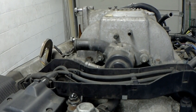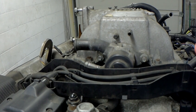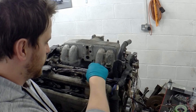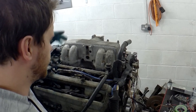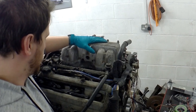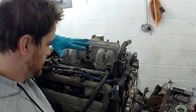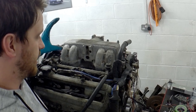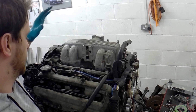At the front we've got this - checking my trusty diagram - it's an idle speed control valve. I guess I'm keeping that; the rest of it stays. Everything seems to be water cooled on this, which is bizarre to me. So what I'm going to attempt to do now is take all this cabling off to clean it up a bit. I might take the inlet off to get at the starter motor and there's bits and bobs I need to do under there, including cleaning it out because it's absolutely stinking in the V.